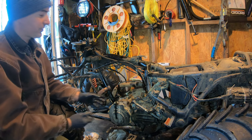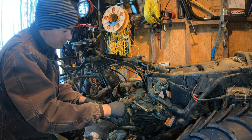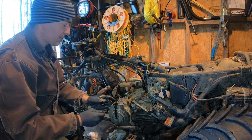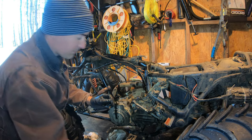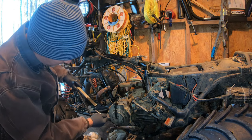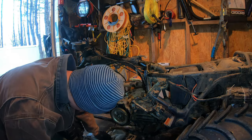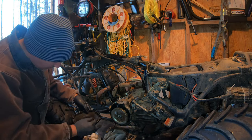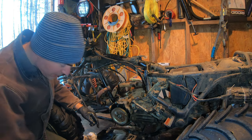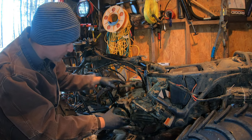I've got to rotate the motor so I can bring the piston up to remove it. There's a wire coming out on this side — I expect that's my stator side. I'm taking this plastic cover off so I can rotate the motor from underneath and line up top dead center. Every bolt is a chore on this motor. Broke one off pretty flush around what would be the pull-start wheel — not going to hold out much hope of getting that one out.